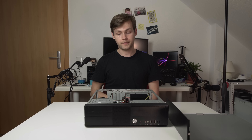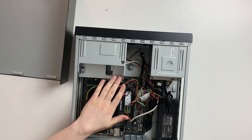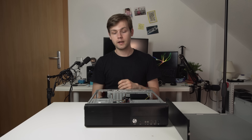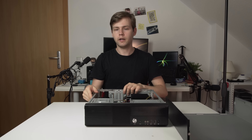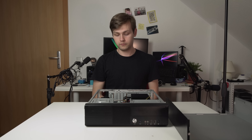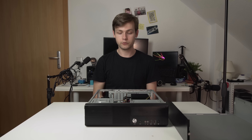The second thing is airflow. I'm really concerned about the longevity of the components in this case because the CPU is running passive and this box doesn't really have any space for additional cooling or fans. I was able to stick an 80mm fan in here, but it's very noisy — I could bear it for about two minutes and then had to turn it off. So today we're going to build a new NAS that's more expandable, more compact, and has proper airflow.